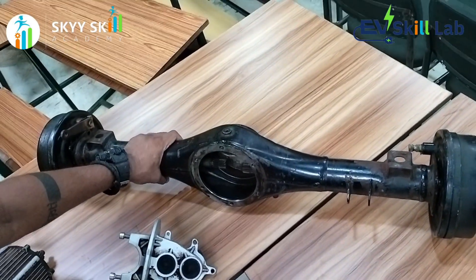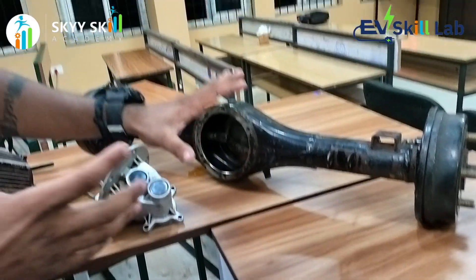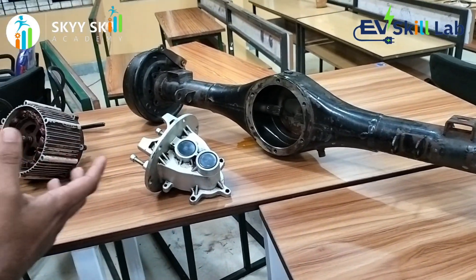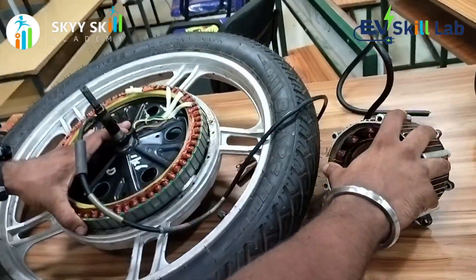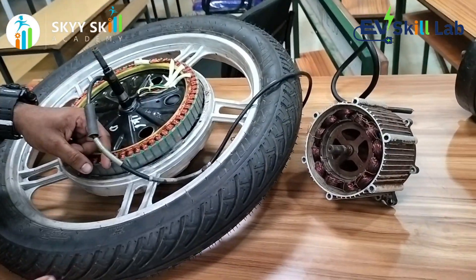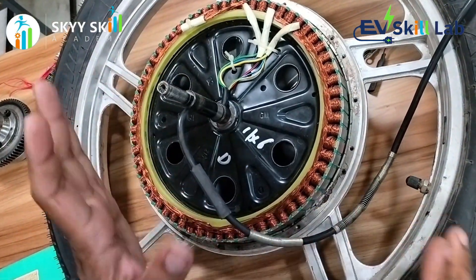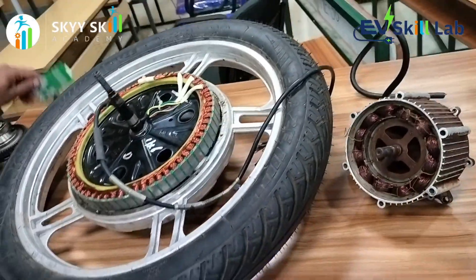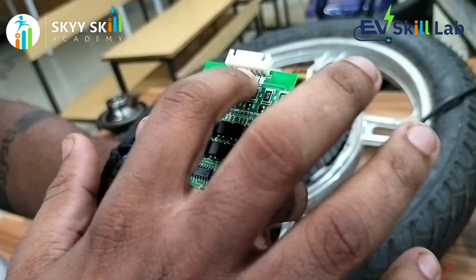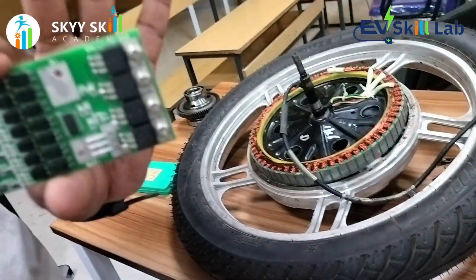We also have our differential. In a three-wheeler, the differential gives different speeds and is attached to the rear wheel system. The gearbox and differential — how it connects to the motor and what components are inside — everything will be given so students can develop their own things. We have two types of motors: an inrunner motor seen in the three-wheeler and a hub motor seen in the two-wheeler. Students can learn about the internal parts, hall effect sensors, windings, and connections. We also have open BMS sections showing the ICs that manage and save cell data.